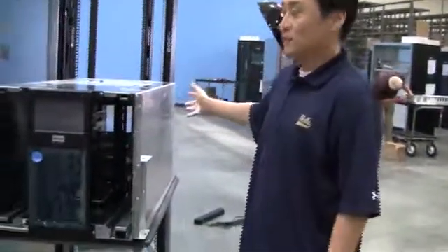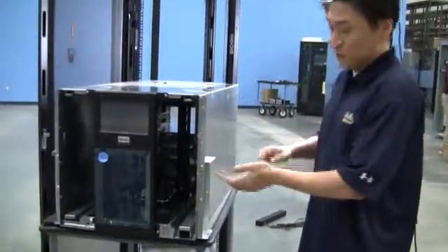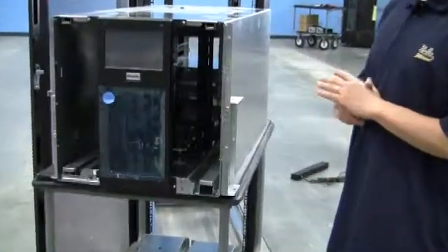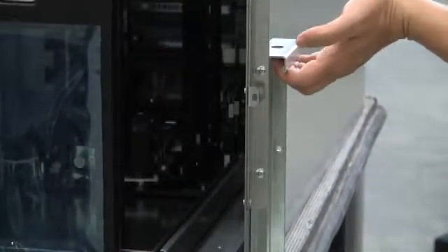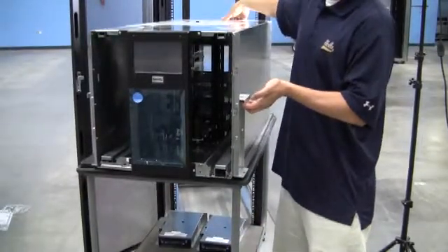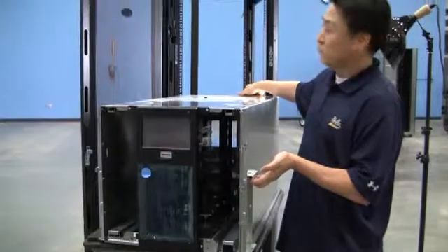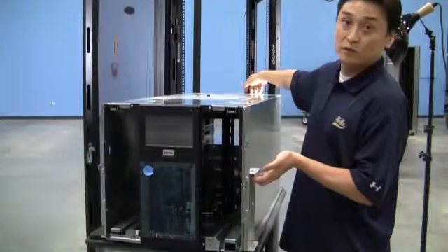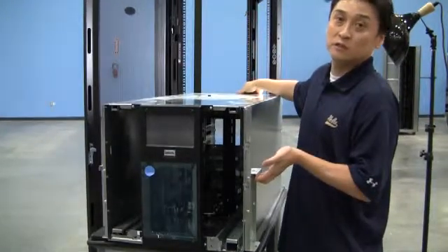After removing the storage matrices and tape drives, you're ready to place the library into the rack. To lift the library, you want to use at least two people. There are handles on either side of the library — position one hand here and use the positioning handle in the back to lift. You should have someone on the other side, and maybe even three people: two to lift the sides and one for the back. It is heavy, so position yourselves carefully.